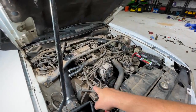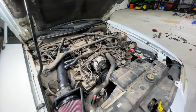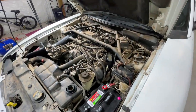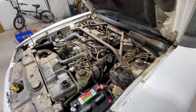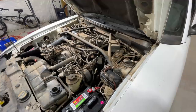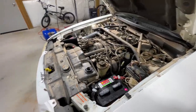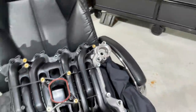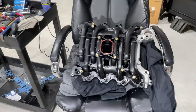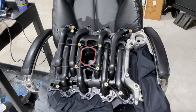The coolant is leaking around where the spark plug wires go, obviously leaking into the spark plug wells, which is causing serious misfire conditions. That's dangerous to drive with — you can damage your catalytic converter, fuel-wash your cylinders, blow up your rings. It's detrimental to the entire car. So we've opted to get a brand new intake manifold — nothing super fancy. I got this for about $109–$119 on Amazon.